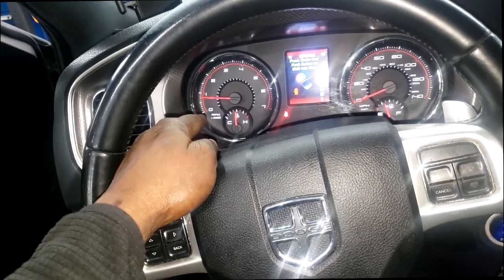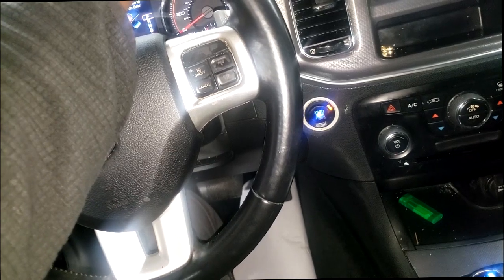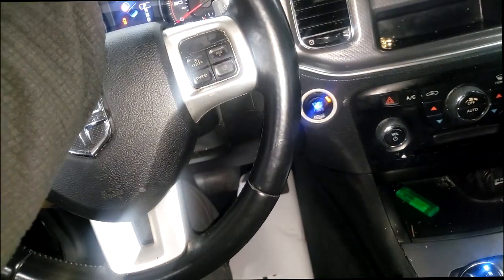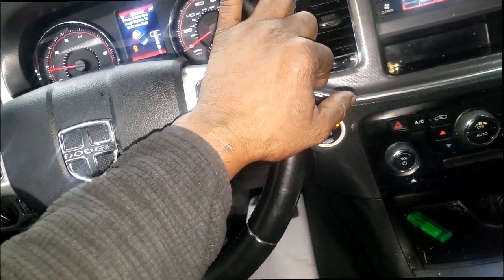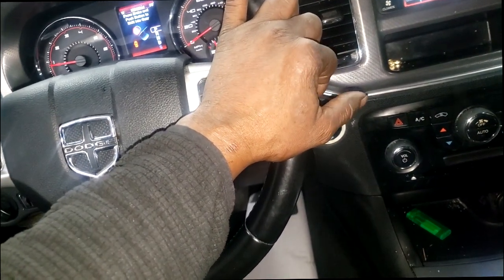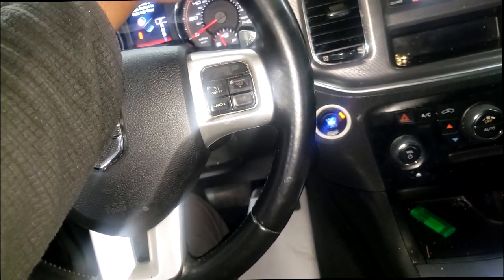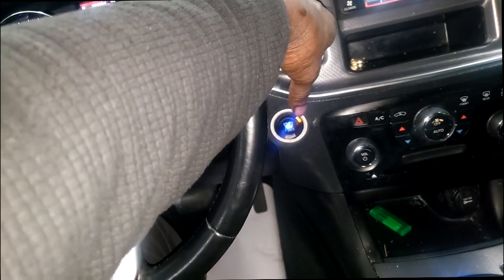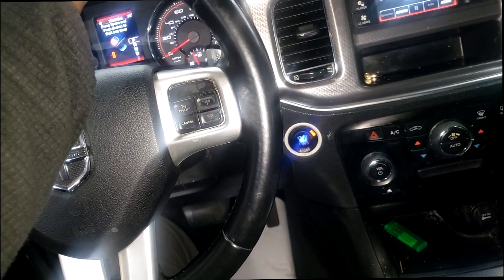They said this hand was going. Mind you, this is all after somebody put a thermostat housing on. Sure, guys, this car would generate a P0128 thermostat rationality code, and the first thing that comes to mind is a thermostat, which in most cases is the problem. Yes, it's easy to replace, but hard to get all the air out the traditional way. And what I mean by traditional way is simply the recommended way, the way you're supposed to do it. That's not going to cut it, guys. You need to go the extra mile.